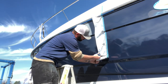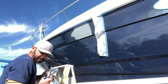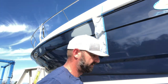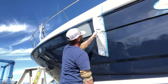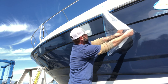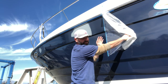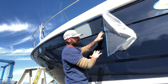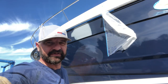Just want to show you this for those that don't know. Pull the plastic out and pull it this way - it makes your tape roll and gives it a nice soft line. It's really easy to polish out when you're finished. That's how I'm going to be masking this off for the top coat.